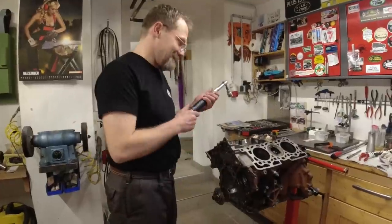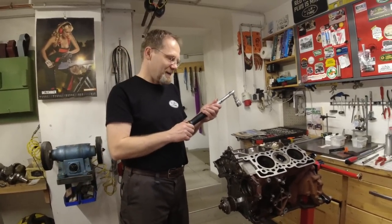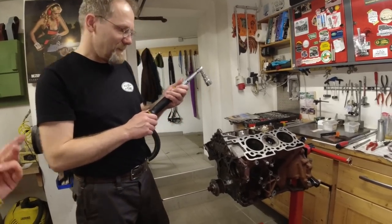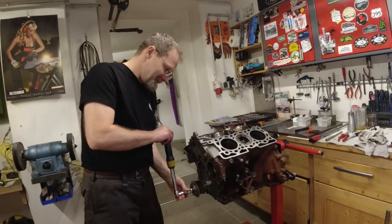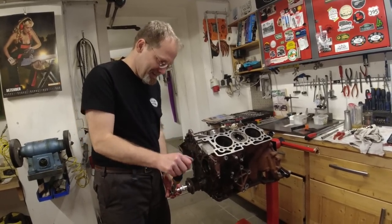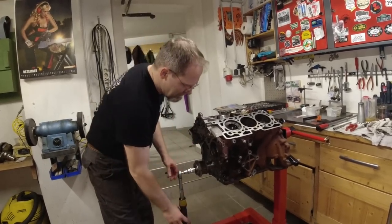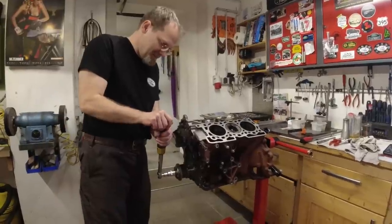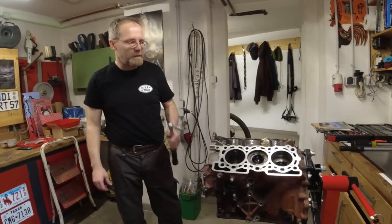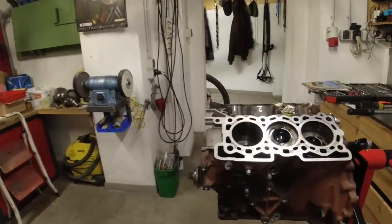I said 12. You had already 13. 12 is not clicking — you want to say the lowest number where it's not going to click. We had already 14. I say 12. You had already 13 — so you said 12? Because 10 was too much. Watch it — he won. So 11. Then 10 was the breakaway torque. 10 clicks. Torque to rotate with all pistons installed: 10 to 11 Newton meters — 25 is the limit. And we have that with a very low clearance on the crankshaft. So that's a very good sign. The engine is gonna last forever.